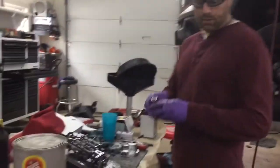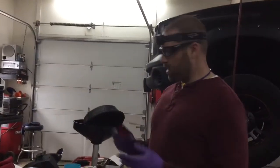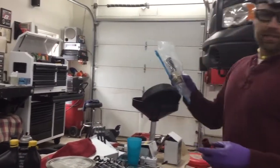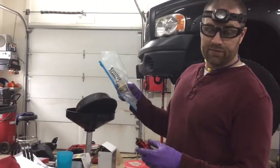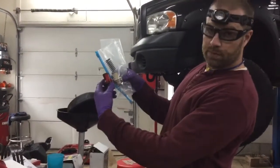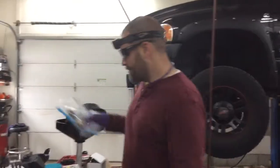This is the accumulator. It sits on top of the valve body when you're putting it back in your transmission. This is an aftermarket one. The factory one in here is a plastic piece of junk — it basically fell out and didn't have any sealing properties. You can compare the two: the billet aluminum with the double sealing rings. Quality. That's going in.